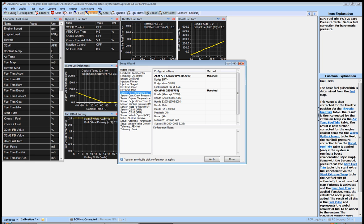Next, set up the air intake temperature sensor. Keep in mind the AIT sensor is by no means necessary for any kind of real tuning with the AEM. Its significance comes down to about two maps — both based on temperature: one is a percentage fuel increase (a 2D map) and the other is for ignition timing. The AIT sensor is not nearly as essential as your MAP sensor, coolant temperature, TPS, cam and crank sensors, and knock sensors. Even different GM part numbers cover almost any GM air intake temperature sensor.